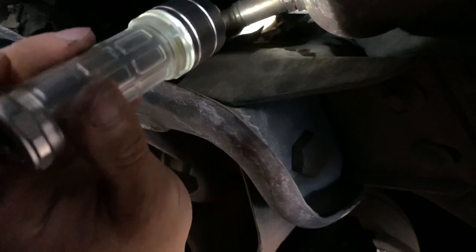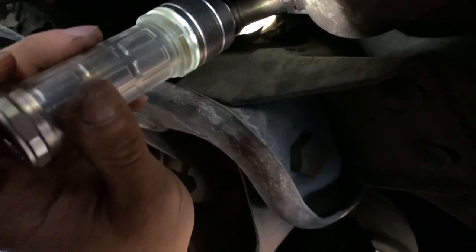We're below the car with it jacked up. That's the O2 sensor I'm getting rid of — we're on the right side, so I'm going to pop that out. I'm not going to hook up my wideband in there yet because I have to calibrate it first. I'm going to cover that connector up with some electrical tape since we don't need it anymore from what I've read — it'll just come straight to the ECU.